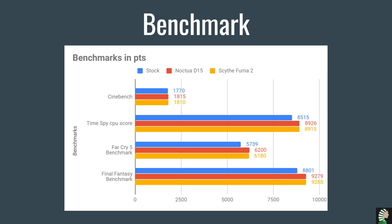Now let's talk about numbers. For this benchmark I'm using a Ryzen 2700X. The reason I'm using an AMD processor is that I really like the way AMD handles boost clocks with XFR and PBO — the algorithm depends a lot on your cooler temperature, so you need good temps to get nice boost clocks. I also want to show you not just temperatures, but what difference a better air cooler makes versus the stock one — how much more FPS you can get.